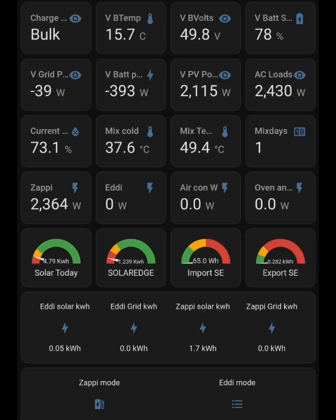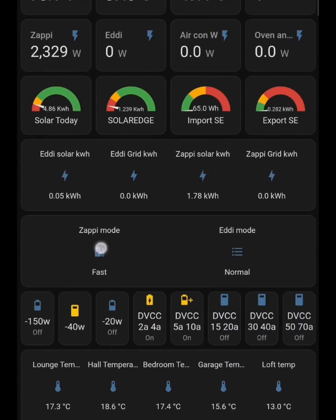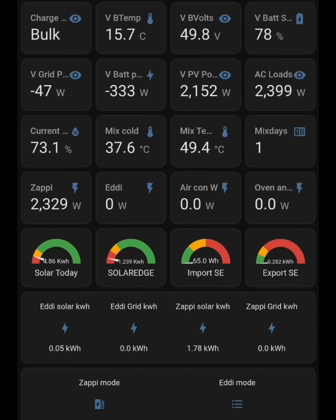Going back to the beginning — the granny charger test definitely didn't use any grid import. So for me the most efficient way of charging without those unwanted tenths is either a fixed-rate charge like a granny charger, or having the Zappi in eco mode with a 100-200 watt export margin set, so if it's exporting it won't be importing. I hope you enjoyed this insight into my data watching and testing. Let me know in the comments how you charge your electric car, whether you see this grid import issue, and if you've found an optimum. Take care — more videos to come soon!